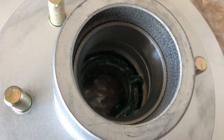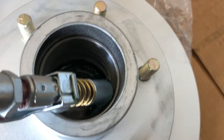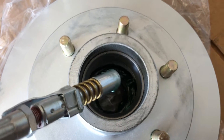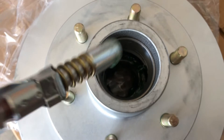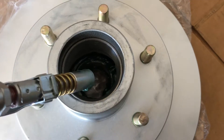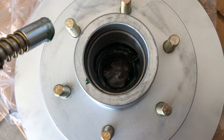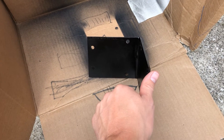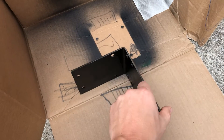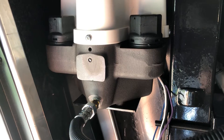I flip it over and do the same thing — squeeze and put grease around the inner portion of that bearing. I'm actually not going to put the outer bearing in yet; I think it's easier to slide these on with the outer bearing off and then pop it on. I'm pretty sure my axles have the easy lube zerk on them to fill the rest of the cavity. I'm also hitting this uncoated bracket with a little bit of spray paint so it doesn't rust.